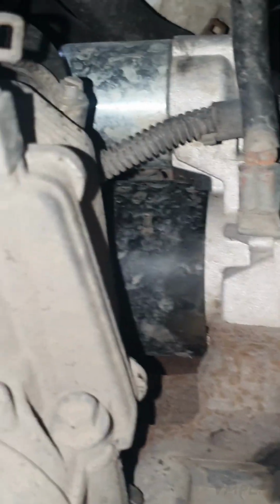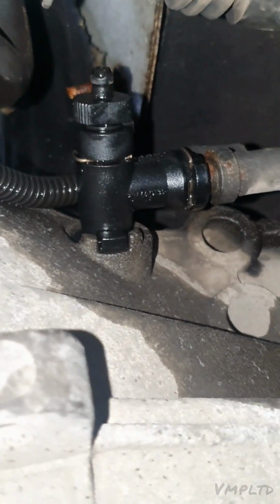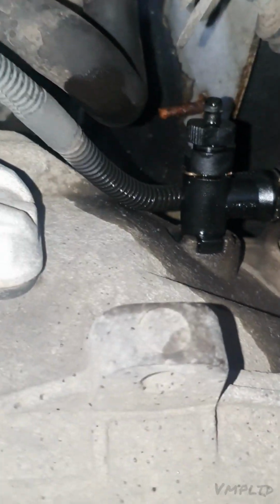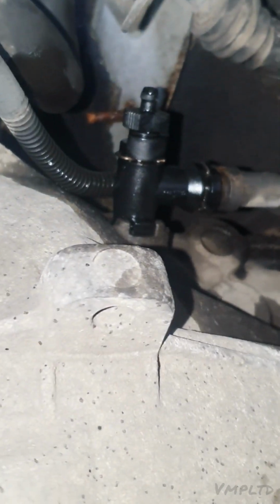So then you're going to go underneath the vehicle as we are now, and you're going to go to the gearbox, if you're using this van, which I'll put the van's details in the description. This one looks like it's had a starter motor recently, to be fair, but that's where your slave is. So that's just that little black tap looking thing just there. Ours is a little moist because we've just done the bleed, just to see what the issue was with this pedal. But it's quite simple.